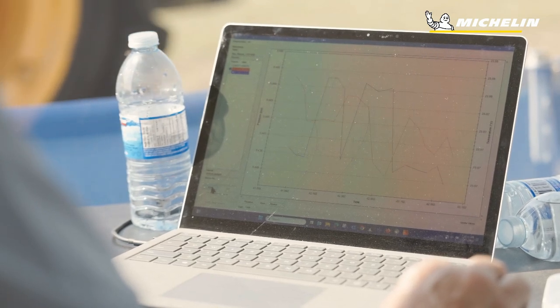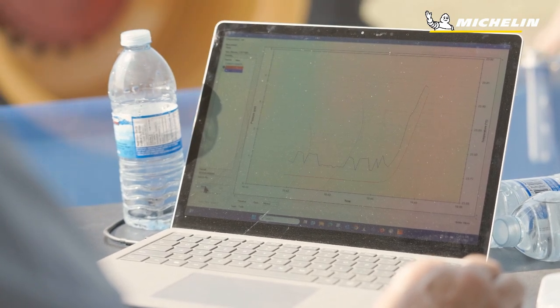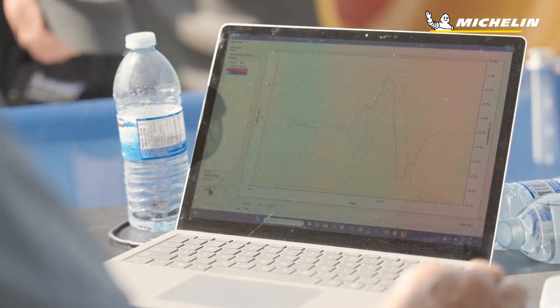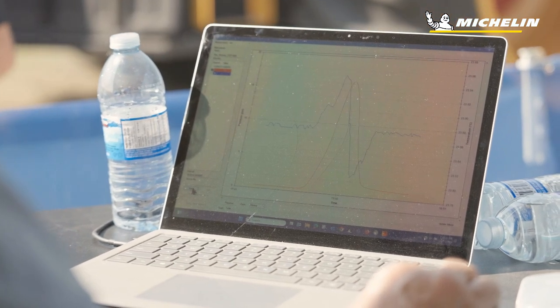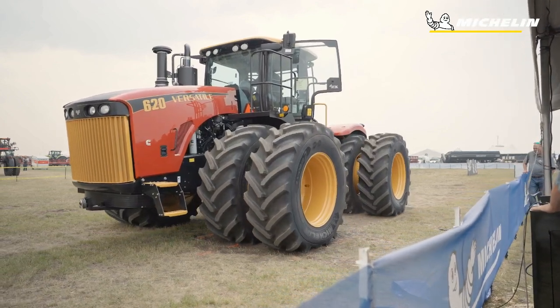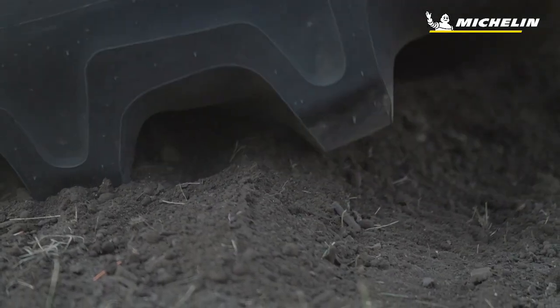This is the actual test screen. Once we hit start, you'll see a red line start coming across, and as he drives over, you'll be able to see those pressure spikes. You can either watch the spikes or watch the tires conform over the probe. Watch how the Michelin high-flex tire at low pressures rolls over the probe area, and then when we come around, you'll see how that LSW tire climbs up and over a little bit — it doesn't roll over and conform quite as much.